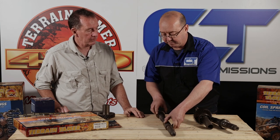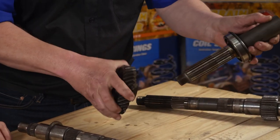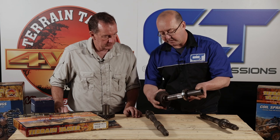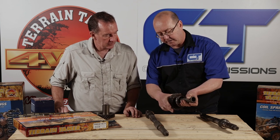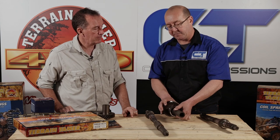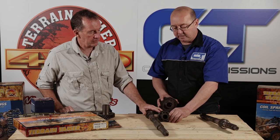Here's another transfer input shaft - they wear on the splines where the transfer input gear goes, and the gear itself also wears. You can see the amount of movement on it - and that could strip too. If it does, you are stranded. Any amount of play on any gear like that will only accentuate itself and get worse, giving you an audible backlash when driving. As it wears more and more, eventually it strips. That's the weakness of the R-box on the 79 Series diesel.